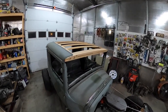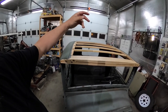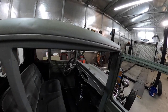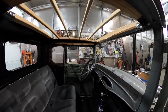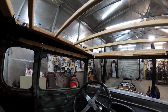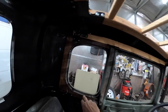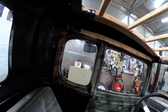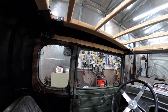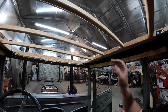You can see there where I put the new header piece in, put all the top bows, and put these pieces here in. If you come around here and get in the car and take a look up, you'll see what I've got in now. This piece of wood here is still good — there's nothing wrong with it, so I'm not replacing it. The pieces around the quarter windows were good, just as solid. So I'm not going to replace any more than I have to. I think the wood kit turned out pretty good. Hadn't ever used that company before, but it fit pretty daggone good.